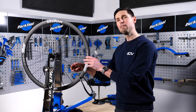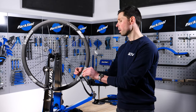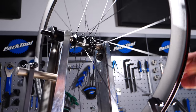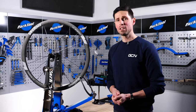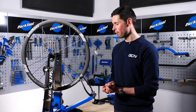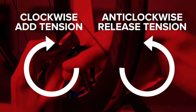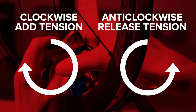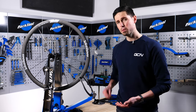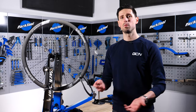It's also important to work in even amounts. Working on pairs is quite often a common phrase used in truing a wheel — you work on a pair of spokes at a time and then assess the wheel as you go, making only small changes. To add or remove tension, you turn the spoke nipple itself, which has a threaded interface with the spoke. Turning the spoke nipple anti-clockwise reduces tension; turning it clockwise adds tension. By adding tension, you move the wheel rim across to the side where the spoke attaches to the hub.